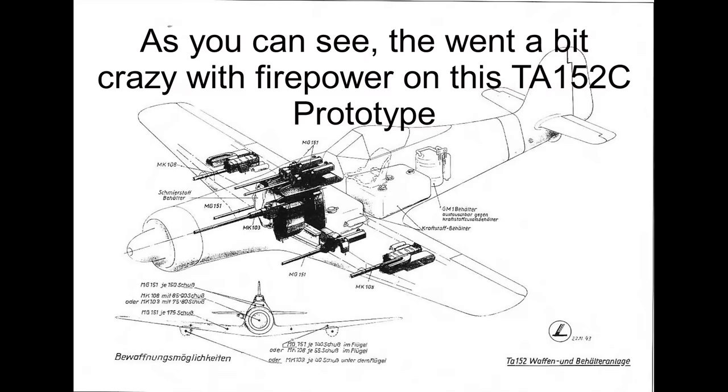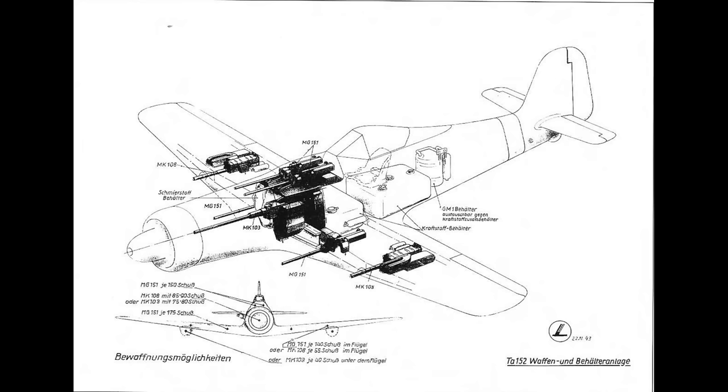First of all, when you compress this gas, it turns into a liquid. That liquid is dense. Thus, you can get a lot of nitrous oxide into a relatively small bottle. It's going to turn back into a gas when released into the supercharger intake, which in this application is where they spray it, but the ability to store it as a liquid is a huge plus.